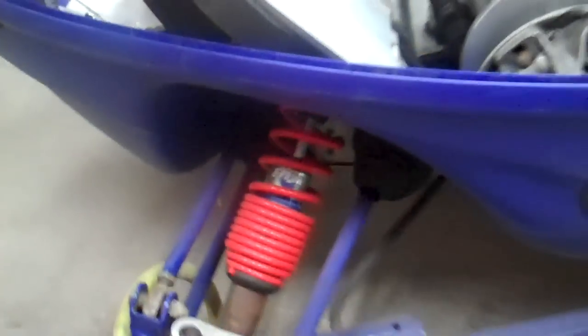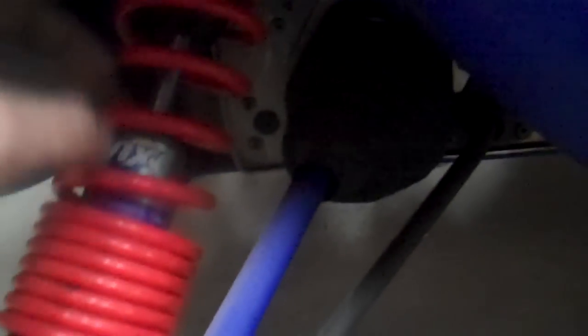If you've got rebuildable shocks, they're probably good for about a season or two depending on how you ride, where you ride, and how many miles. You could check for leaks in the shocks — if you don't see any leaks, they're probably fine, but rebuilding them will help. Check your carbides and see what kind of life you've got in those. There are probably three or four grease fittings under here you're going to want to do, usually at the top of the shock tower, and there's one at pretty much every pivot point. Make sure you hit all those grease fittings.